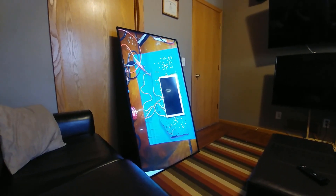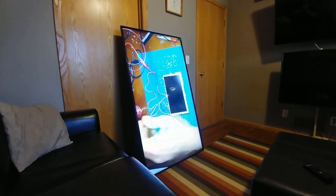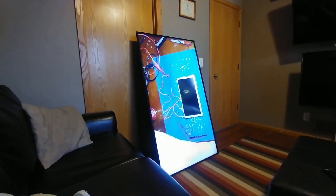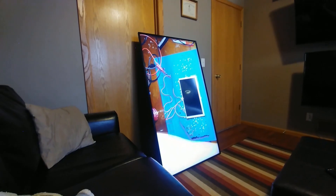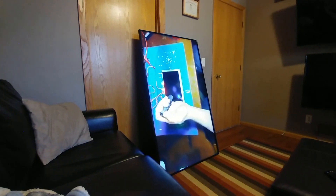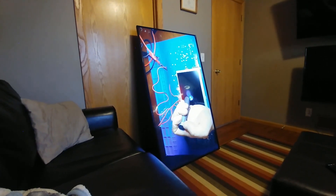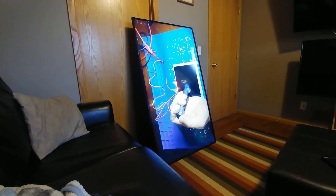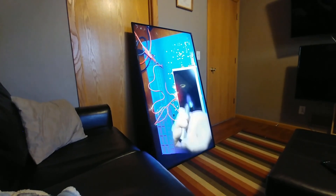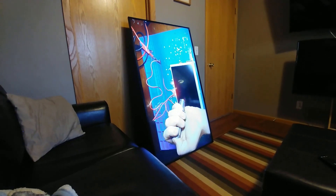Just to be clear: removing those resistors doesn't fix the problem. The problem is still there — it has failing LEDs. The right way to fix this TV is to replace all the LEDs. All we've done today is buy it some more time with the old LEDs. Eventually enough of them will quit and you'll start to notice the backlighting getting dimmer and dimmer. At that point, you can put those resistors back in and install a new set of LEDs. Hopefully someone finds this helpful — thanks for watching, see you next time.